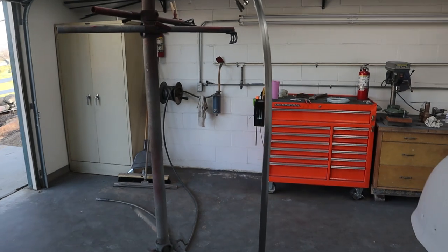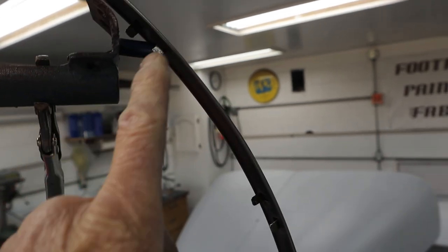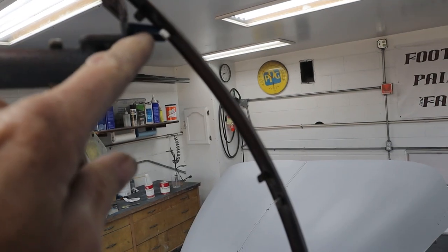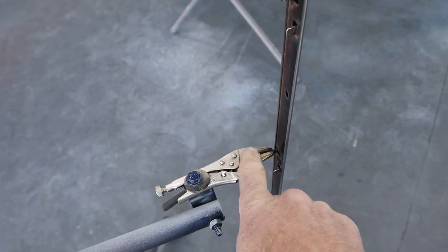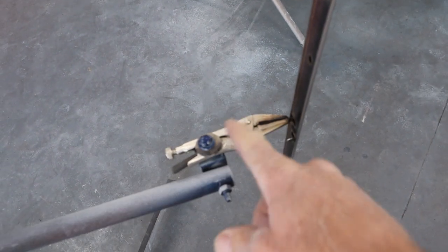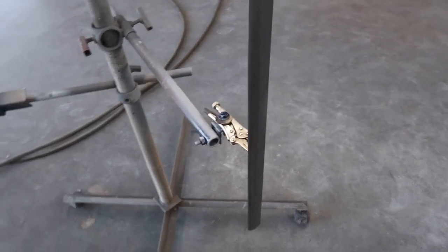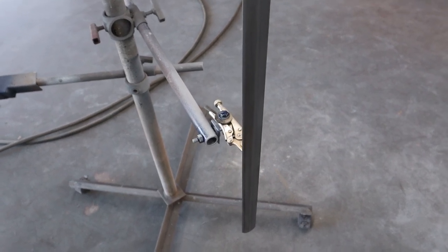I've got the molding up on the rack. To hold it, I took a piece of wire, bent it, and poked it up inside where one of the tabs has a hole, then put a standoff on it and pulled it tight with a vice grip — it's held pretty sturdy there. On the other end, I used a pair of long-nose vice grips pinched onto one of the tabs and bolted that to the arm. I'll throw a little tape around both of these so I don't get etching primer all over the vice grips. I'll roll it outside when we shoot it. Let's move over to the bench, mix up some etching primer, and get this thing sprayed.